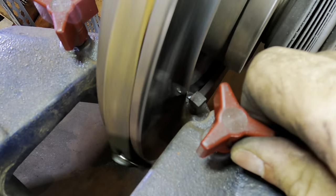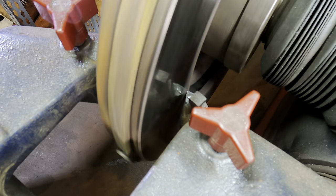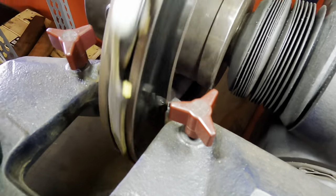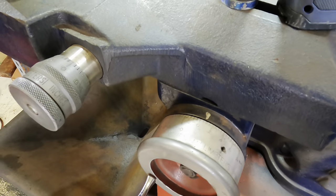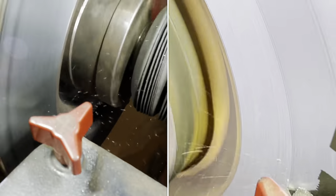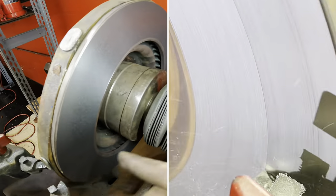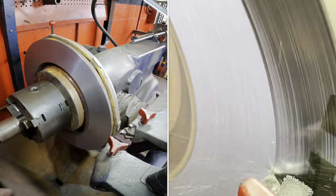Watching the fingers. They do another pass — I did about two thou on each side. Go ahead, put it back into gear. Up and back. Beautiful. Back in neutral, power down. Look what we've got going on here: the entirety of the old surface has been cut away, but we're not done — we have to do one more pass.